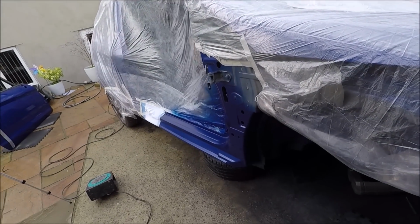Right, so what I'm going to do now, that's got to be flat back. I'm just speaking to Martin from Busby Body Shop, the one I mentioned on YouTube in the last video. I'm just trying to work out whether I need to flat the spots now and then put a base over the top, then lacquer, because I only want to get one more base on, or do I need to flat, or can I put another coat on and then flat just before lacquer? So I don't know, see what I've got to do, but it was going so well. We got 3 really good coats on.